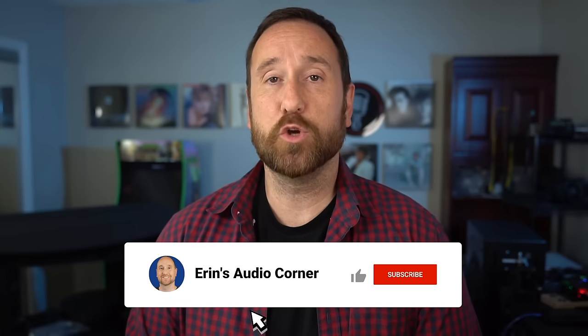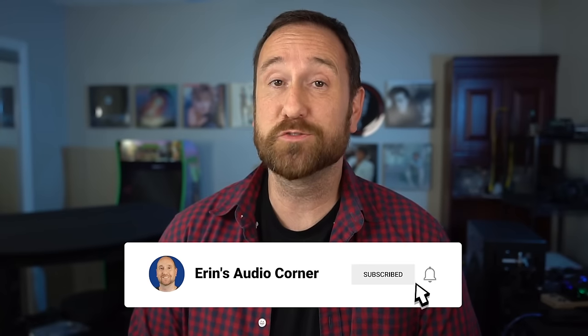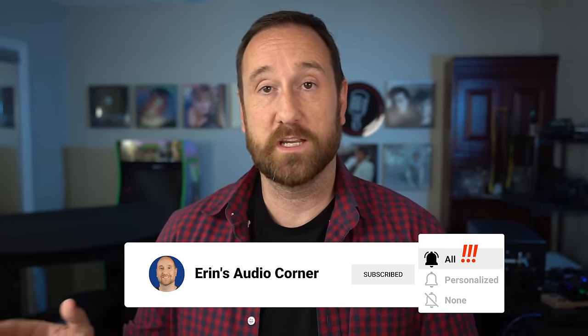This really is a very neutral speaker in that it plays almost flat from 20 hertz to 20 kilohertz. When I put them in my living room about a foot off the wall, there was actually just too much bass. So with the app, I went and adjusted the bass contours. There's a mode called wall mode that allows you to adjust not only the bass but also impact some adjustment into the mid-range. I'll show you some data for that in a little bit.